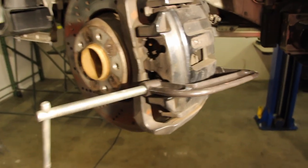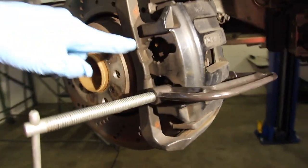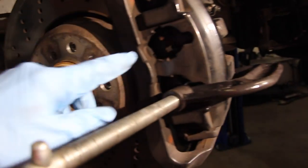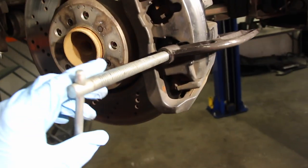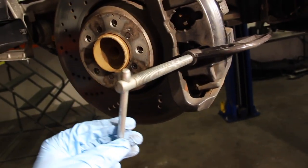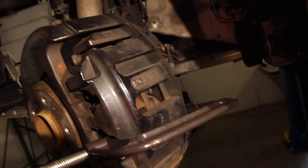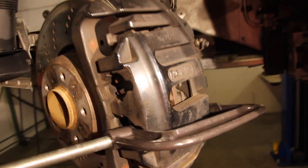My C-clamp is just large enough - I think it's labeled a six or eight inch; you might want to have a ten on hand for this. The pad is what you're seeing here with these little spring clips on it. Since we're not reusing the pad, put the adjusting end of the C-clamp there. The other end fits around to the other side of the caliper. It'll move fairly easily for a while, get a little tight, and then when it gets real tight, stop - don't force anything. What that did was retract the pistons back into the caliper, giving us room to slide the whole caliper off the assembly.